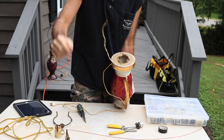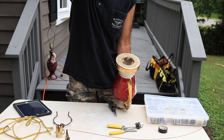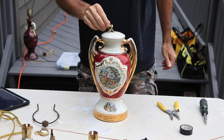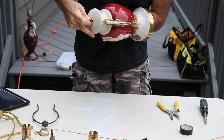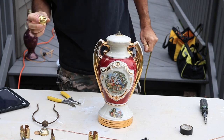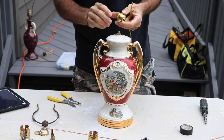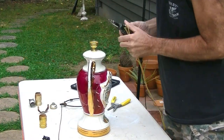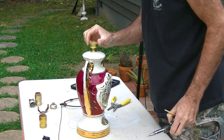Here's the part that's stripped — and that's it, this is junk. Typically this part will already be done on your lamp, but I'm replacing the thread right here, so I'm just going to show that real quick. Luckily my hand fits up in there. I got my threads inserted and adjusted to the height I wanted. Just thread this on — this one does have a set screw, and I'm going to use that to tighten it up. One tip: don't set that set screw too tight, or you'll wind up messing up the threads underneath, and when you take that off next time you'll strip the threads out. It doesn't need to be that tight.